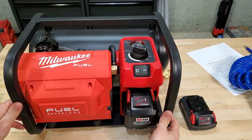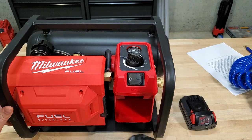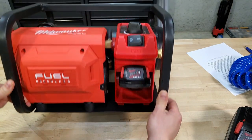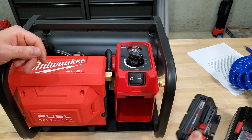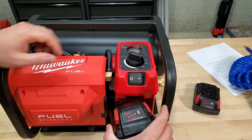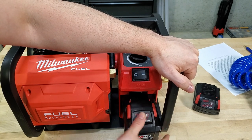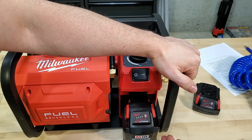With the battery compartment up here, I've got a 12 amp-hour in there right now. This takes any M18 battery, so it will run off 2 amp-hour batteries, but that looks ridiculous and you're not going to get much runtime. I really wouldn't recommend using less than a 5 amp-hour. One thing to note: when putting a bigger battery in, do not hold it by the sides — the way the roll cage works, you're going to pinch your fingers. Hold it by the tabs instead.